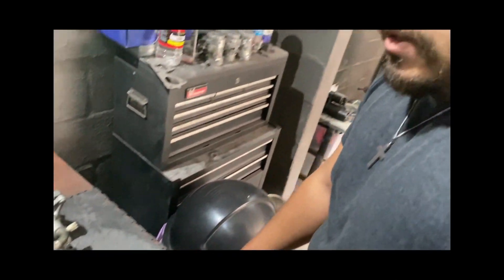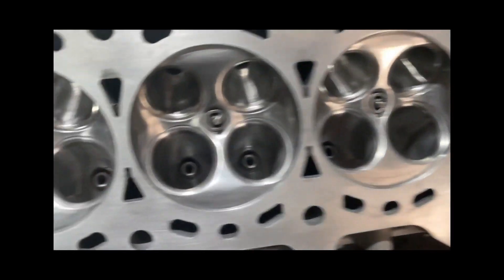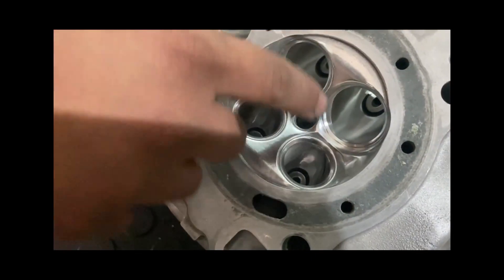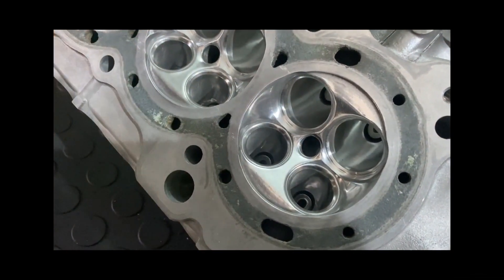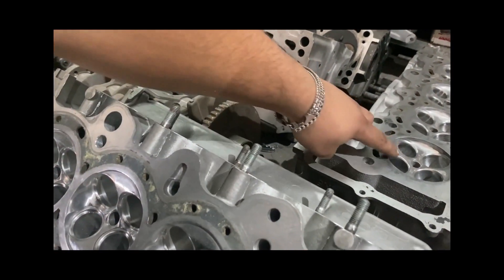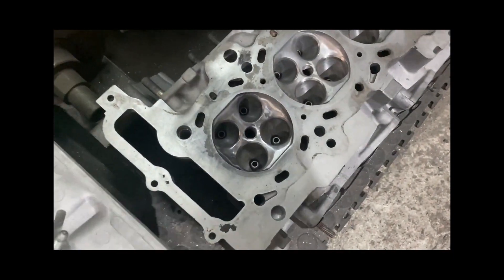You don't need to overdo it — just push it as far as you can. The point of polishing the chamber in this case was mainly for aesthetics, but also I pushed all the edges so that when the valve opens just a millimetre there's nothing blocking the flow. See that lip there? Imagine the valve open just 1mm — that lip gets in the way. This VVL will be flush with the seats — it'll get a re-cut to a three-angle seat. That's why I do it, basically just to help low-lift flow.